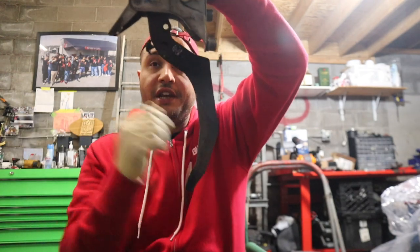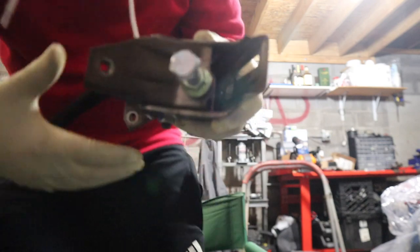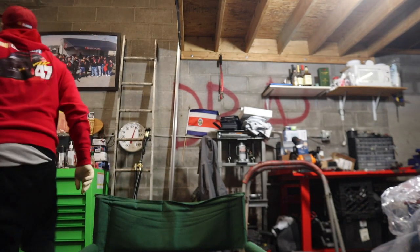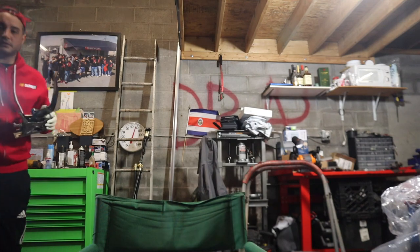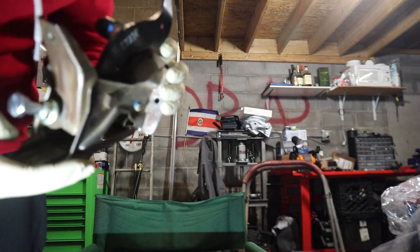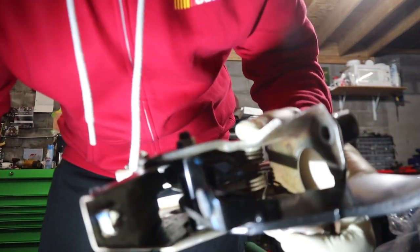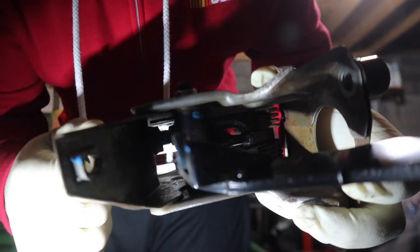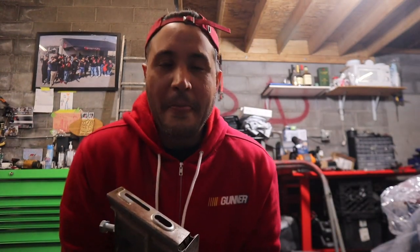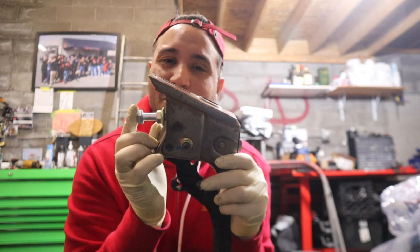You never want to press the clutch this far in — that's why it's called a clutch pedal stop. You can see it right here. See how you adjust it in and out? Clutch pedal stop — very easy. 17 nut and bolt, finito.